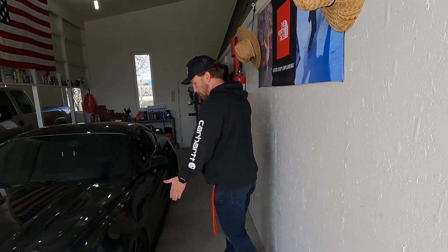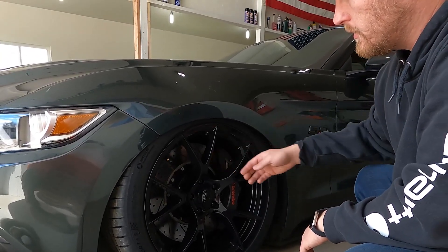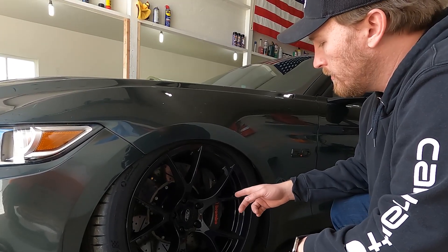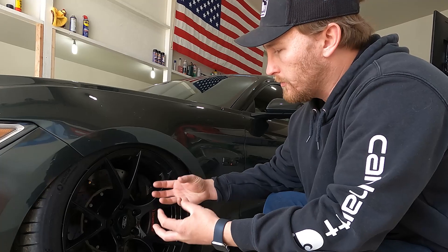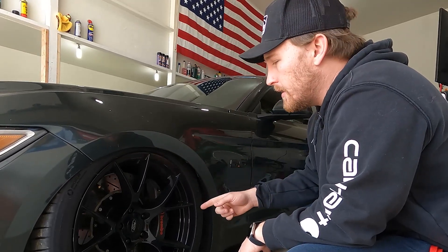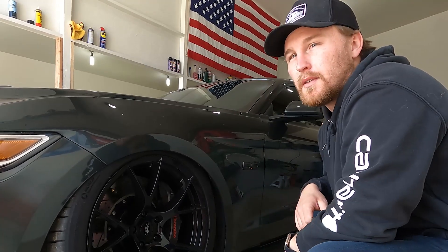We also got new wheels, and I did brake pads and slotted and drilled two-piece rotors — those are Baer — and the pads I believe are Hawk. The reason I did that is the stock Brembo ones threw off so much dust and just bit immediately. With these it's more linear: you can push on the brake and it'll give you some time to modulate, but if you really push hard it'll still stop just as hard.